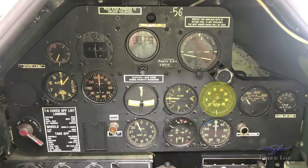Here's the RPM gauge. On takeoff, with the propeller full forward and full throttle, the airplane will turn up 2,300 RPM. After takeoff we'd bring it back to probably 2,100 to 2,000 RPM depending on climb rate. Once at cruise, you bring the propeller control back and the governor maintains the RPM you've set. I cruise this around 1,850 to 1,900 RPM.